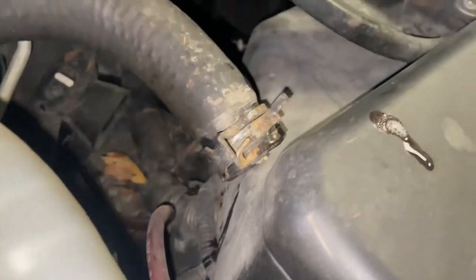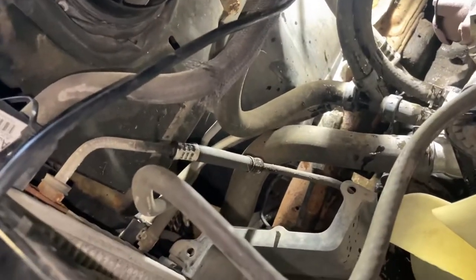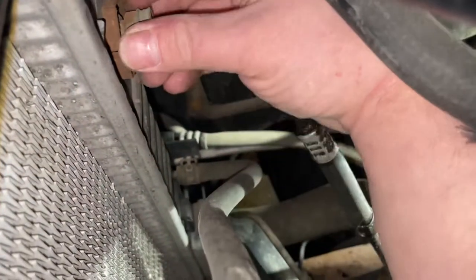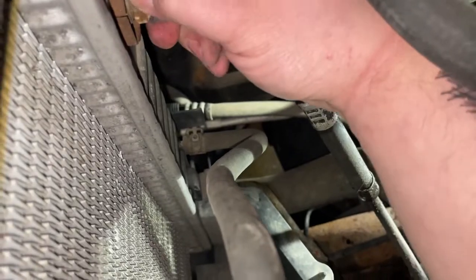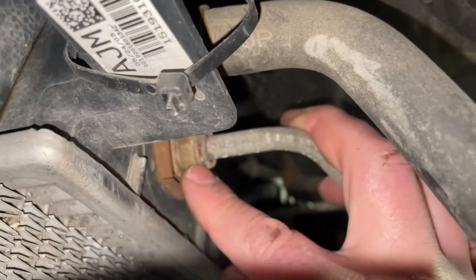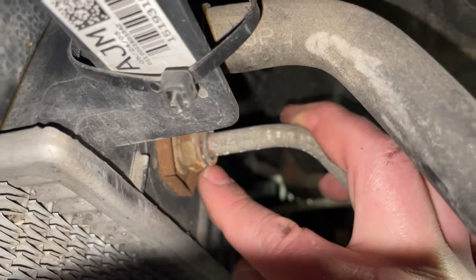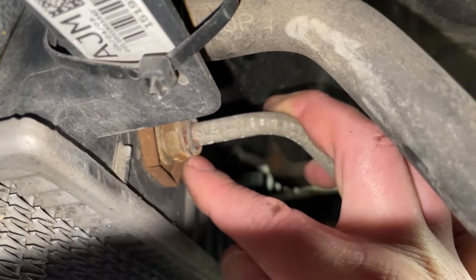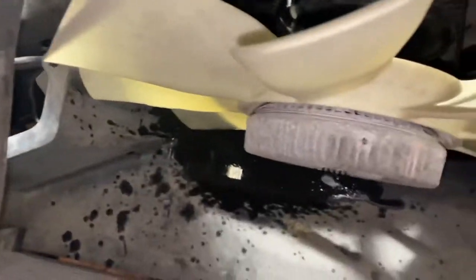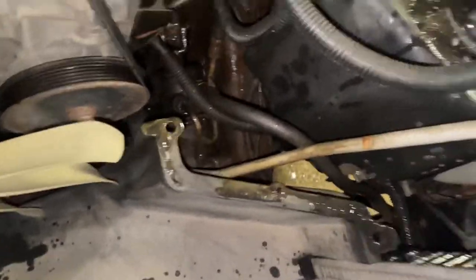On this one we have trans and oil cooler lines. This one's held on with a hose clamp right here, and then this one's a little bit of a specialty — you pull this black piece back and you can see it's a little crusted. There's a little clip inside there; I usually use a tiny pick to get it out. It will go flying on you, so make sure you don't lose it. If your new radiator doesn't come with one, keep track of it. Go ahead and get this bottom half of the shroud out too.